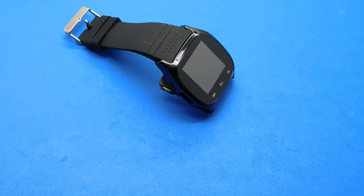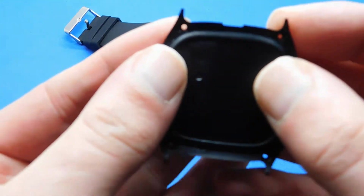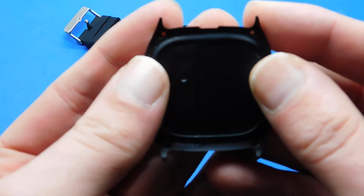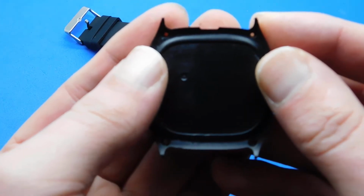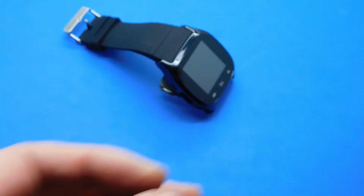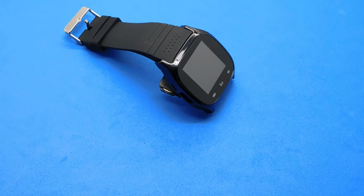The strap overlaps the back cover to cover the access hole and lift off. So basically the extension on that strap covers that port there, covers that part of the back cover, this bit here where my finger is, and it just overlaps that to cover it. See if it'll focus. So it covers that, the strange design. So this is why you need to take one side of the strap off, because of the overlap. So take out the 4 screws, which are PH0 size. There is a slot cut into the back cover, so I've shown you the slot. So be careful, do not stab the battery.